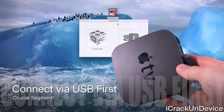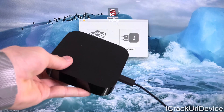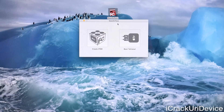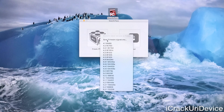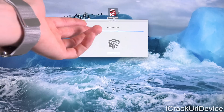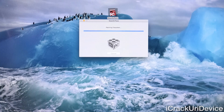But if you try before you plug in your Apple TV, it will ask you to connect it to your computer. So let's go ahead and connect it now via a micro USB cable in the back, connected to the computer. Once we've done that, we can again right-click on Create IPSW and select 6.2.1. As you can see, it's stating that it's validating the IPSW and going through this process. It will actually download it for you — I've already downloaded it previously through Season Pass, so it's just preparing the custom IPSW to restore our Apple TV to. The download process shouldn't take too long — just ensure you have an active network connection.